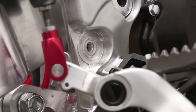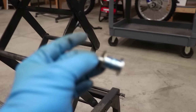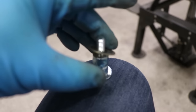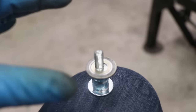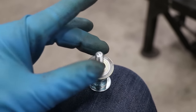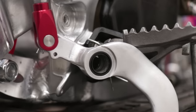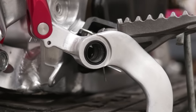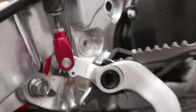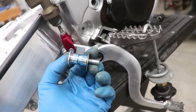Somehow I ended up losing the washer that goes behind the brake pedal. I pulled this one off the 125 — you can see the 250 uses a slightly smaller thread bolt, so I'm gonna have to order up one of these washers. That's a pretty critical piece. Since the brake pedal pivot is such a high-use area, you want to pack a bunch of grease inside the pivot of the brake pedal, behind the brake pedal, and on the brake pedal pivot bolt as well. And don't forget to put some Loctite on those threads too.